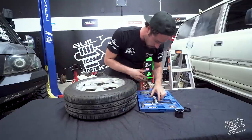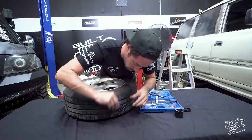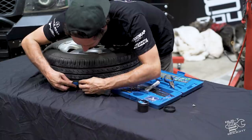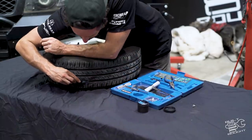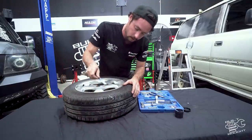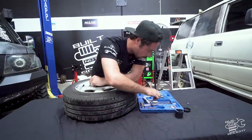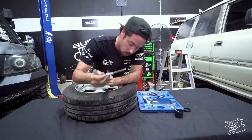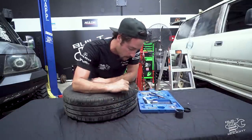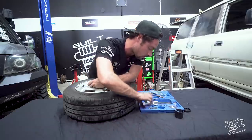Driving the car, the road will wear the excess rope off as well, but you can nip the end off with the blade. It's that simple to repair. On the road I always keep one of these kits with me. If you get a puncture, pull the nail or screw out, make the hole a little bigger with the reamer, put your gooey in and thread the needle, push that in as far as you can - it's got a stopper so you can't go too far - then rip it out nice and quick. That is it. Puncture repaired.